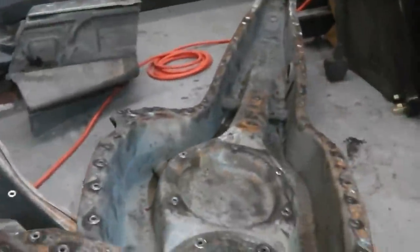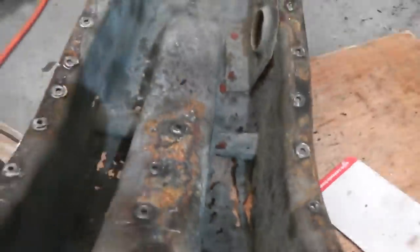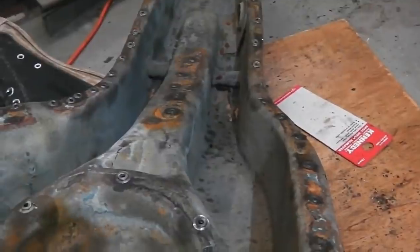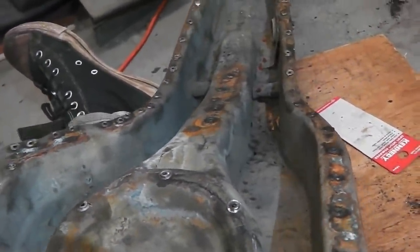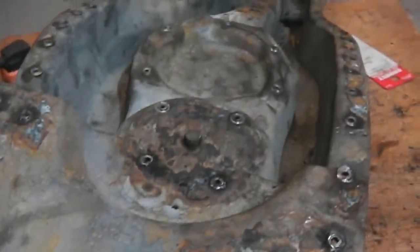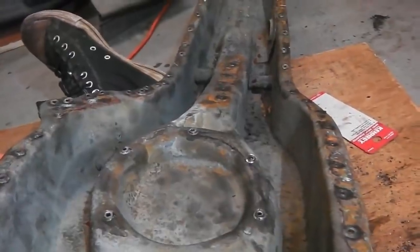We're going to measure from this to where the axle bolt goes through. You can see the axle bolt coming right there across that tube. Now that's going to be getting cut off. We need to make sure that when we put the new piece of metal on, that stays exactly the same distance from a marker point or a datum point up this end, because what you wouldn't want to do is just cut and shut in there and have that slightly too forward or back.